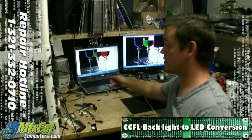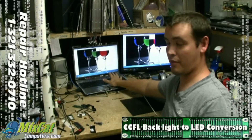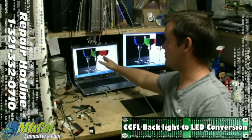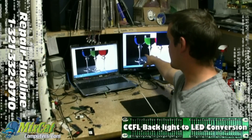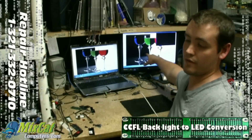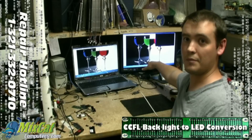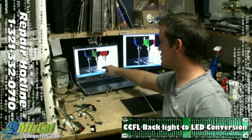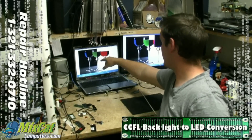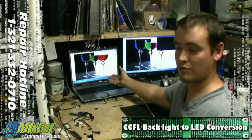Now the reason we're doing this is because, as you can see, this bulb is starting to go bad and this is one of my personal systems. It's starting to go bad, I need to get a brighter screen. This screen is an old Gateway monitor that we've already done the conversion on — this has the LED strips lighting from top and bottom. As you can see from the difference here, this is kind of yellowish, green, blue and red, black and white — they're kind of washed out, kind of faded, doesn't look real clear.